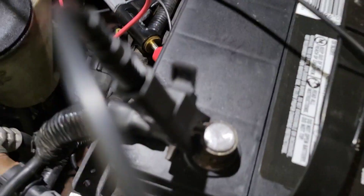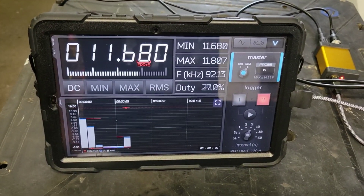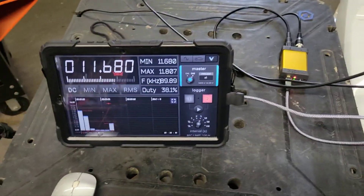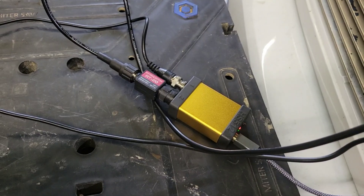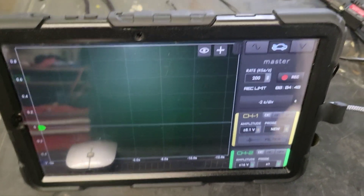The nice thing about Hscope is that channel 2 has a built-in voltmeter, so you don't need another tool. On the coil, we're looking for the control wire — the negative. You can back-probe both wires without hurting anything, just keep your clamp on the negative. I can see the battery voltage is low from doing the other part of the test. I moved from the green wire over to the white wire — that's the one we want, the negative. I also added a 20-to-1 attenuator. I might have gotten away with a 10, but I'm going with 20 — you can't over-protect.